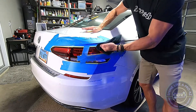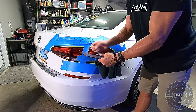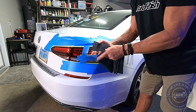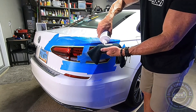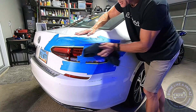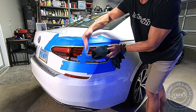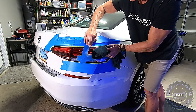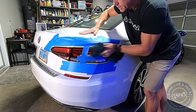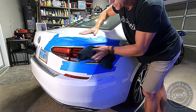You can also use a backing plate. Here's a very rigid backing plate made out of acrylic with a soft pad. I can put some polish on it and apply more pressure because this is a mostly flat surface — I'm not constrained by the nuances of body panels, so I can really lay into it at a much higher level than just with my hand.